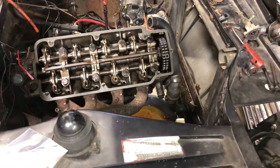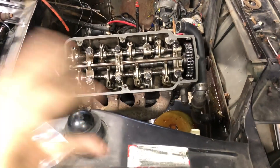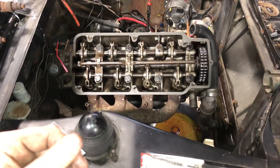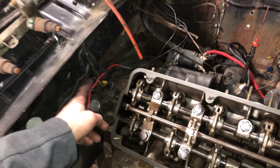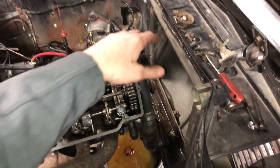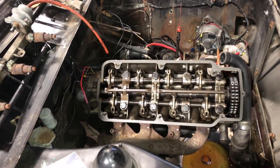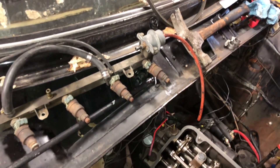There's going to be a lot of other sensors obviously on this, but nothing outside of kind of a factory location. Pretty much everything else runs off of a location like this for the gauge sender. So that's probably oil pressure there, but coolant will come off the top of the manifold. Here's the original fuel rail — I will be reusing the regulator, even though I'm probably going to tidy up the look of it a little bit.